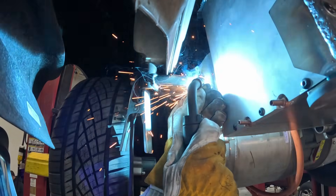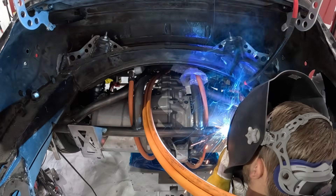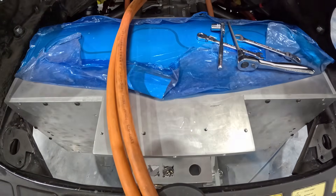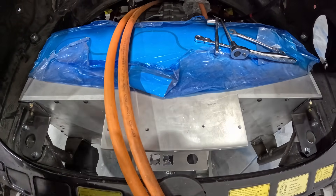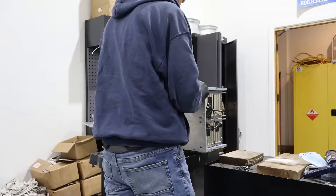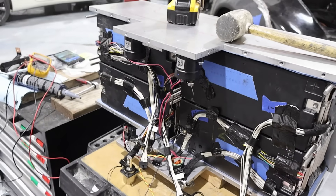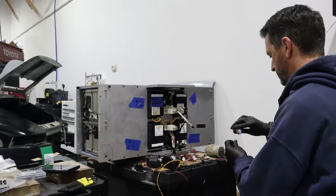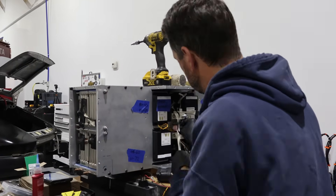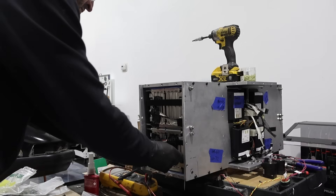I took the battery back out so I can finish welding it up. These rear mounts are all finished — this weld done and this weld done. We only have tacks on these so we're going to finish welding this up. This is the rear Porsche battery box. We're starting to get blades assembled. Got the seam sealer around the seams there, taking this nice and slow. We're going to leave the side panels off for a while, but we're going to put on the front one here. Just got to take some of the components off so the panel can slide on. Yeah, it's looking good.